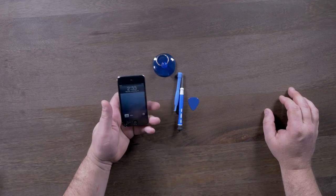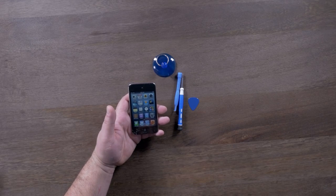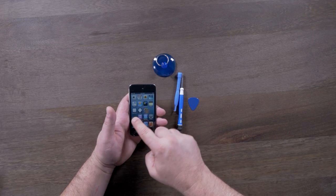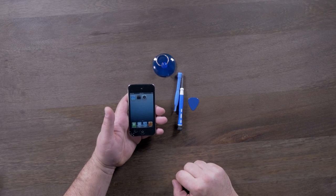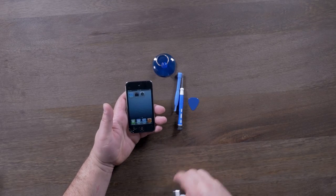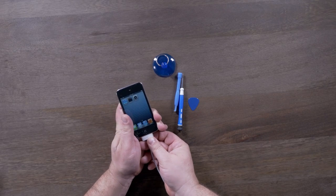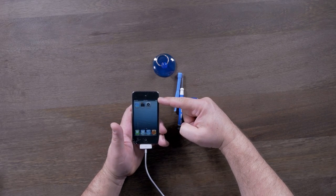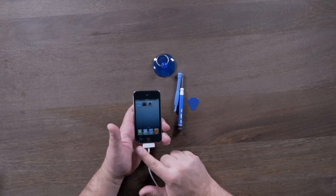So what we're going to do is verify that the display works — we have a picture. We want to make sure the digitizer works by grabbing an icon until they're all shaky, dragging the icon all over. If the icon drops, that can indicate a problem with the digitizer or with the logic board itself. Double tap the home button — the screen should pop up. And most importantly, make sure the device is charging. The iPod Touches will only give you a battery charge indicator; they do not indicate actual battery percentage. When we connect, we make sure we get that audible alert to let us know the loudspeaker is working.